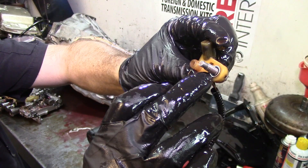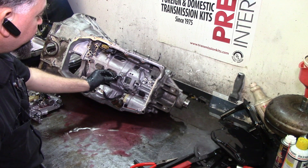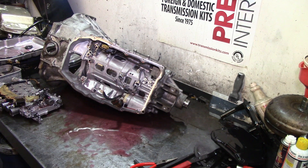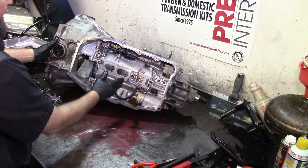What I like to do so I won't lose my bolts — I just drive them back in. They have a plastic alignment dowel that aligns it to the case and the bolt doesn't come out. I just drive it back in there rather than risk losing it. Let's go ahead and take this seal off. We have a center support there and we've got to apply these frictions here. We'll talk about the frictions later once I get the parts.